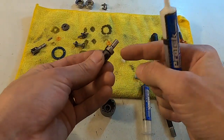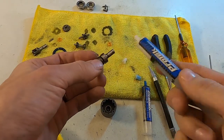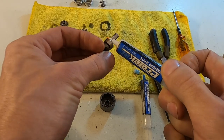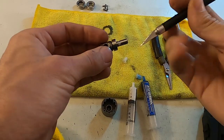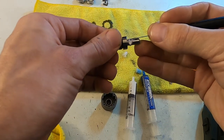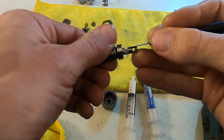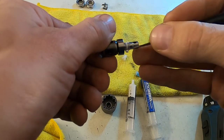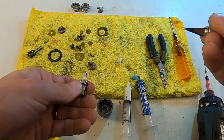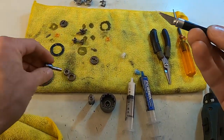So we do double bearings. The first bearing slides onto our outdrive, then I put a little coat of grease on here and use the Xacto to smooth it around, getting it fully covered into the groove.